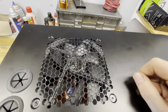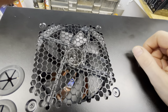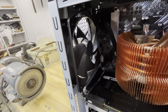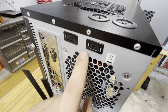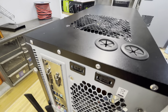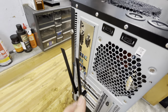I'm using the stock exhaust fans that came with this case since it was brand new. Unlike the original 300 where the top fan had started to wear out, this one is brand new, so even though it's an older Antec two-speed fan it's still pretty quiet. These fans are two-speed and you can control the speed from the back — there's a high and a low position. So if you're playing a really demanding game, you can reach back and turn the switches up to increase exhaust speed and move more hot air out of the case.